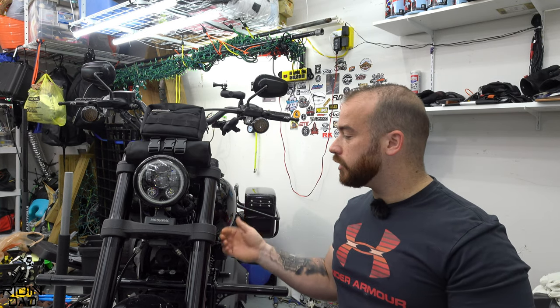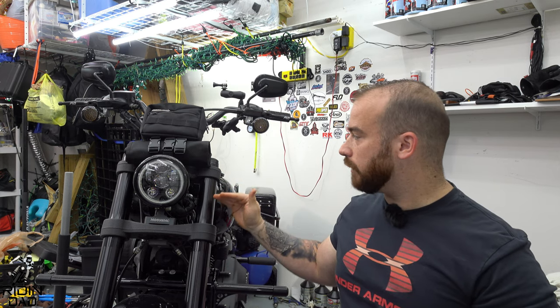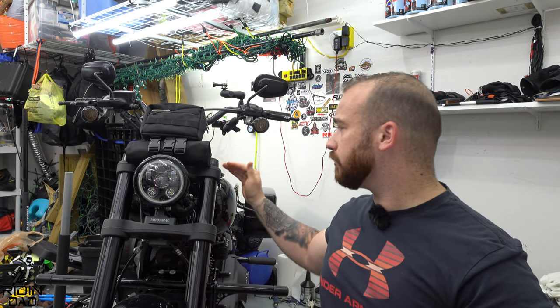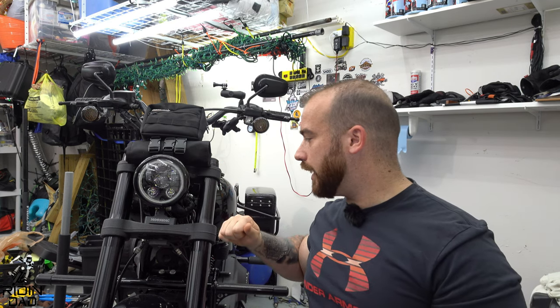First thing we have to do is loosen all of these. I already have the bike jacked up. Once they're loosened, I'm going to jack it up further. I have a pneumatic jack on the back, and then a very small, old school manual crank jack for fine adjustment, which I'm going to put in the front of the bike and jack it up ever so slightly. That way we can get it very even, resting on the floor but even still. Then I'm going to tighten the top tree clamps first, then the bottom, and put the shims in there. I'll bring you guys closer, and hopefully it should be a pretty easy, simple install.